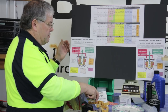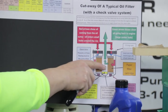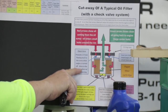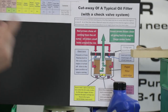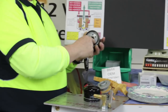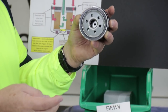There's another variation of these oil filters. Everything pretty much remains the same — the oil comes down, goes through the filter, and you have a bypass valve. But one other thing you may find on filters is what's called a check valve. A check valve is a little silicone or rubber ring just inside the opening of the filter itself, and it's a one-way valve. It prevents oil from draining back out of the filter when the filter is on its side.